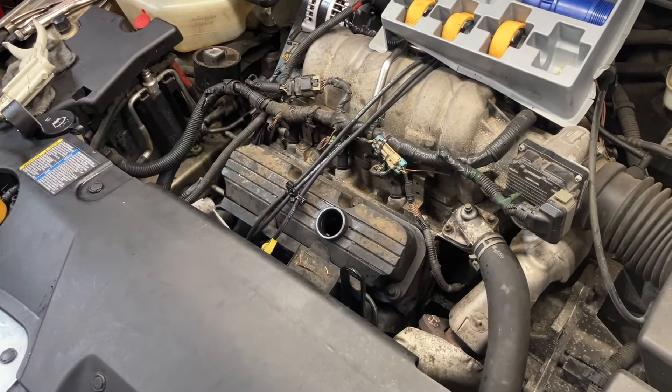But we'll see — I'll just wait on it here and keep watching it. After waiting about another five minutes, she has not dropped at all. She's still just on that side of that black line. I look down there and there are no drips. I think this cooling system is good. I'm just going to let them drive it for a while, and if it does develop a leak there again, we're going to have to do a timing cover — but hopefully not.